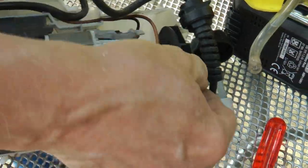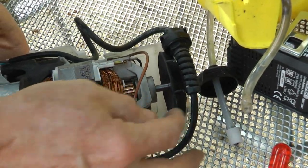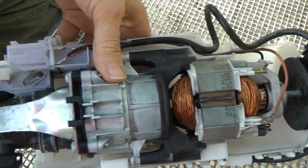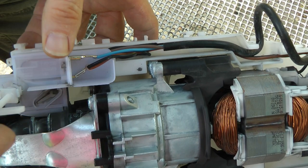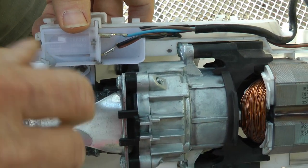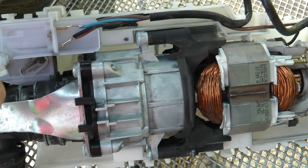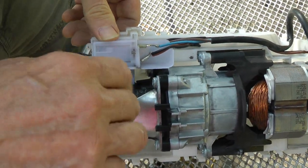So we've got the fanny bit and then the brushes. The brushes look all right actually — I can't see that there's anything wrong with them. And then a motor with a winding. And then a pump. And then that's where the mains comes in. So there's a pressure switch in there, obviously. That thing there — that's the on-off, that goes in the back of your control knob in there. So that's the on-off cam, and that should make it run or not run.